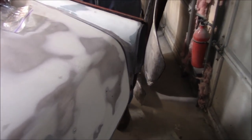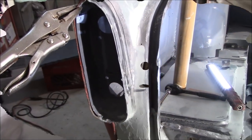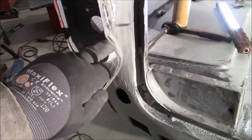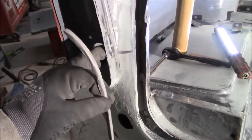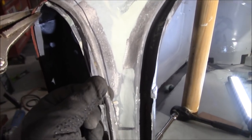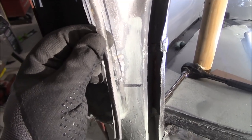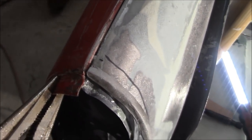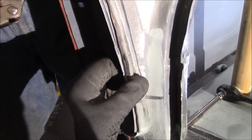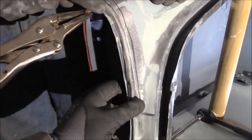So we said we're going to work on the tail light pocket, so I've just pulled the old tail lights out so we can see. Stuff's falling all over the place anyway. We're working on the driver's side tail light and we figured the best course of action — it's not as easy as just cutting this and extending it back, because it's actually two layers of metal in this pocket. So what we've decided to do is make something like this — just a little filler piece. We'll weld that in and grind that down, should be good as new. And that will match along the top. So it's going to look something like that — obviously we'll have to shape it a little bit better, but that's what we're going for.